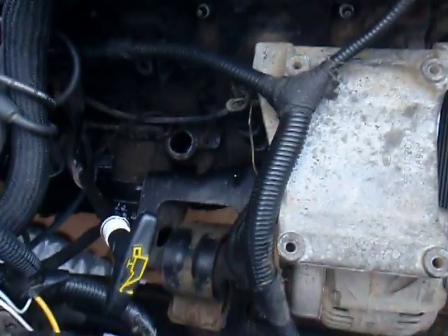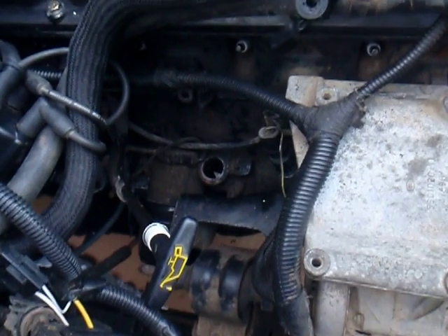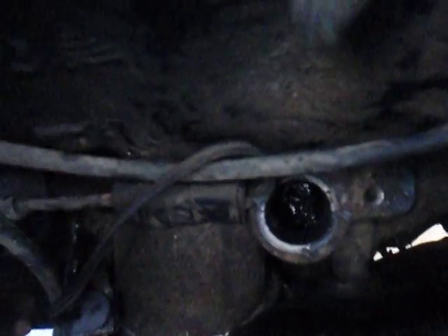Alright, this is a video from my record-keeping to verify that I'm installing the distributor correctly, and it seems that I have the wrong distributor shaft. Currently — I'll guarantee you can't see it through there — but the oil pump slot is at about 10 o'clock, a little before where it's supposed to be.